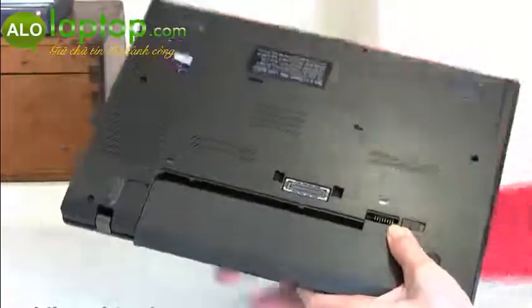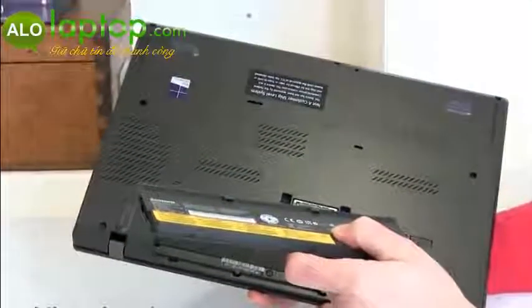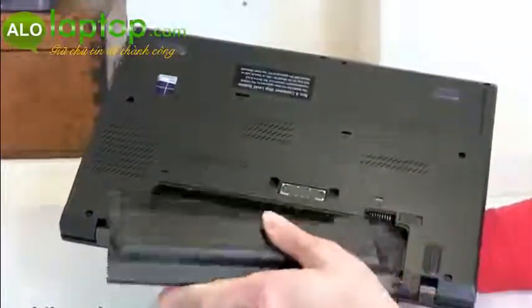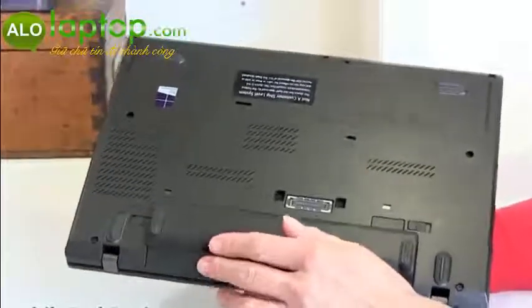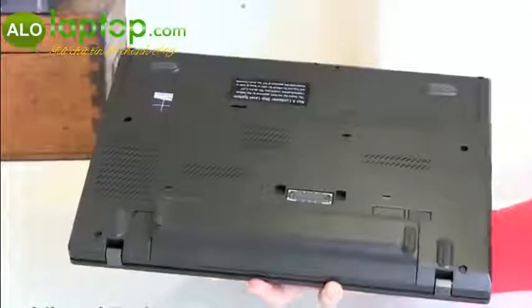So, the laptop is actually turned on and sleeping, and it doesn't matter if we take this out. And this is the standard slim 3-cell battery that sits in there flush. And here's the 6-cell battery. So obviously it's going to give it some lift. You can see what it looks like right here. And again, no need to power down the laptop. The way it's designed, it's going to always drain these removable batteries first, leaving you with some juice inside. So that's pretty darn handy.